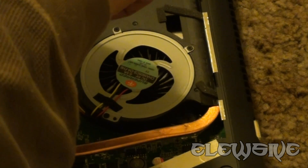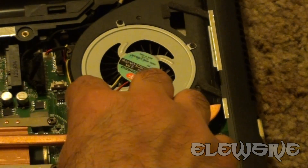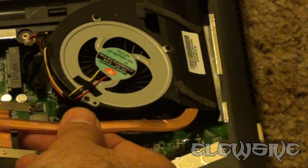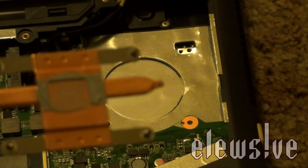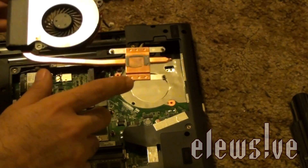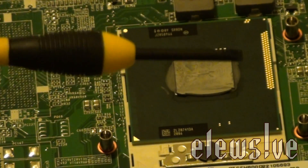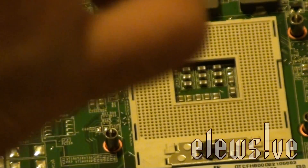I'm going to be removing one screw first, then take out the other screw — and that looks successful. So that is out, and so is the fan. I am just slowly trying to position the fan to get it out of the way. So looking at the fan assembly, this is the actual heat sink — this is the fan assembly — and this is the thermal paste that we'll be wiping off the actual heat tube. When you want to get this processor out, it's actually facing this way, but then you want to move it this way. The socket moves out more, and the processor comes out just like that. So this is the original i3 that came with the motherboard.